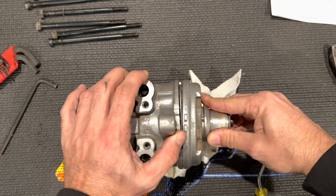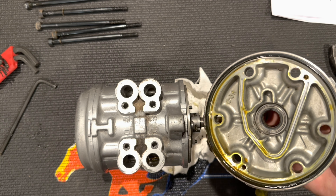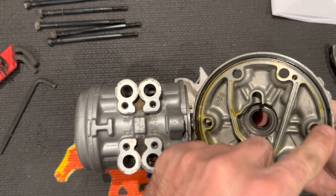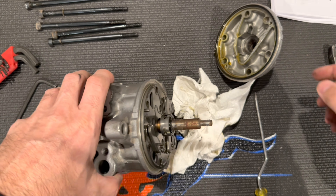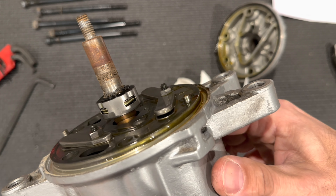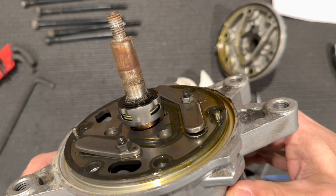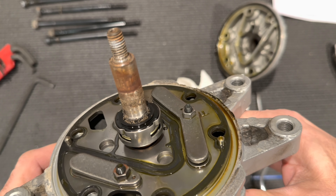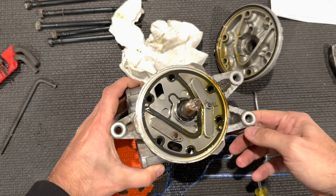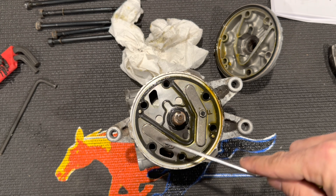Prying here, loosen the front cover — it comes off really without much fuss. There's some oil in there and one part of the shaft seal. Here's the old O-ring for R12. As we tip it back, you'll see there's another part of the shaft seal. If you zoom in, you can see there's quite a bit of grime on that and the shaft is actually rusty. This corrosion, rust, and dirt is really what causes a lot of the leaks — it gets in there and can wreak havoc on that seal, but it can be replaced.